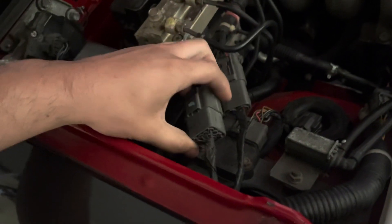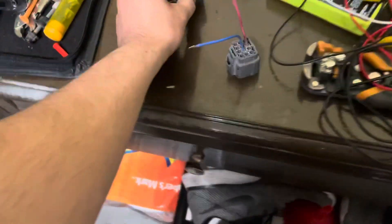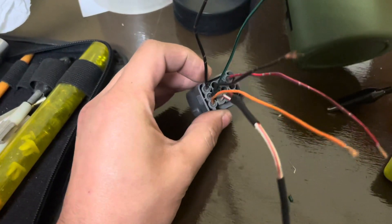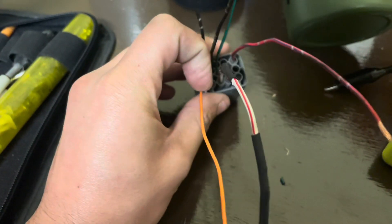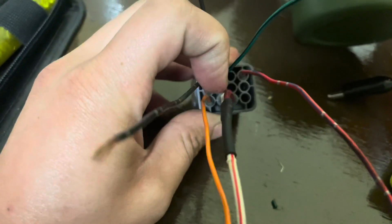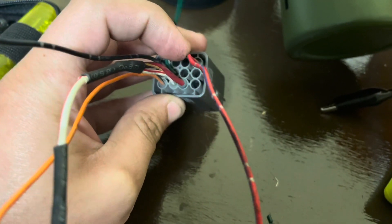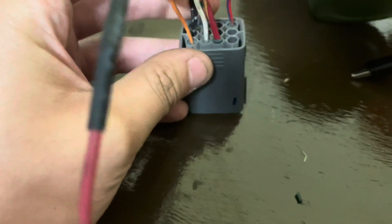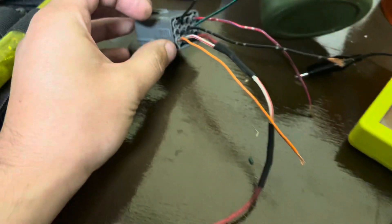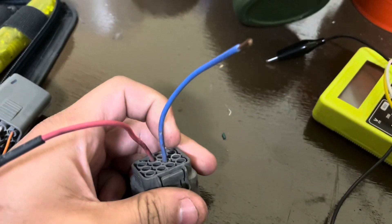To run the valves and the pump you will need to make a little adapter harness that goes in between. In the top left corner is the front left solenoid, bottom left corner is the front right solenoid, the green wire is the rear solenoid, the left wire is the valve relay, the top right one is the pump motor relay, and the bottom two will need 12 volts for the control side of the relay. This red wire is the 12 volt source and this blue wire is ground.